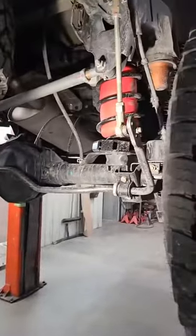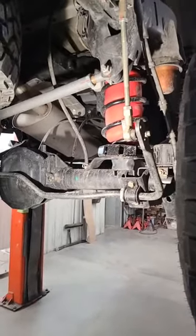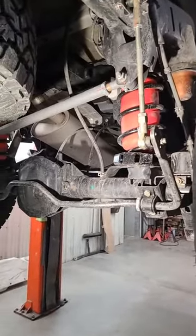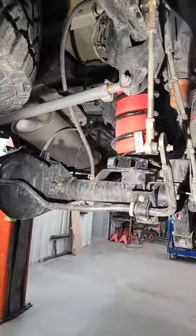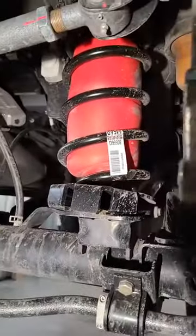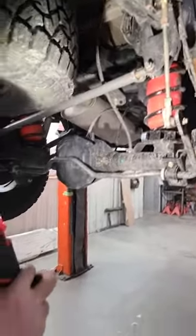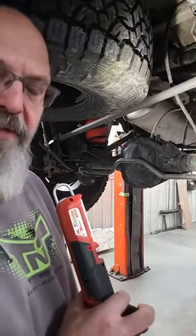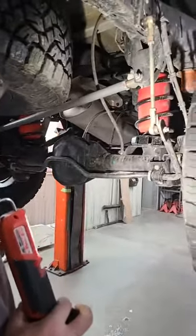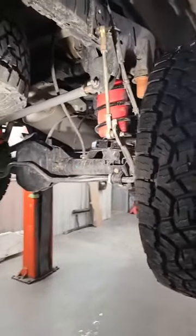The AirLift kit has been on the market for a while. I'm not 100% sold on it yet, but it's an interim solution. Savvy observers will notice the tags on the springs — we went back to factory springs. We ordered a set of the max tow spring because it is a heavier spring than any of the other factory springs, and there is a plethora of factory springs for these. That helped with the weight capacity.